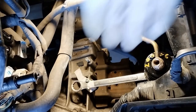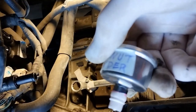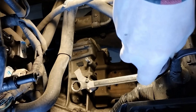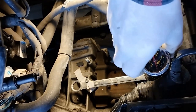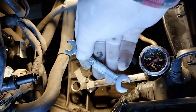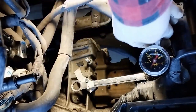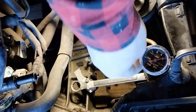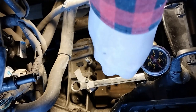It's being stopped from turning by using this spanner here. I've got Teflon on the thread for the fuel pressure gauge — of course, assuming all the threads are correct and I've ordered the right one, which I'm pretty sure I have. As it gets to pressure, the Teflon enters the thread to seal it. I'm using an 11 millimeter open-end spanner to turn it in. I don't want to put too much pressure on it — I think that point is enough, so that should do.